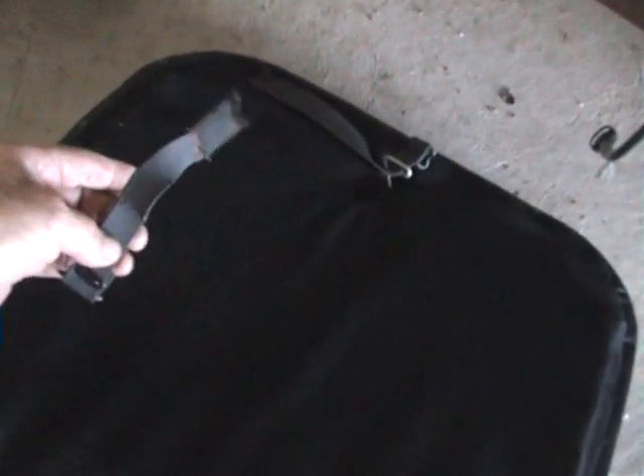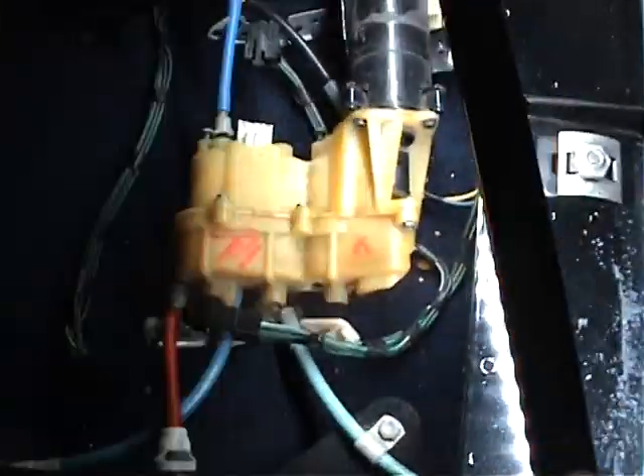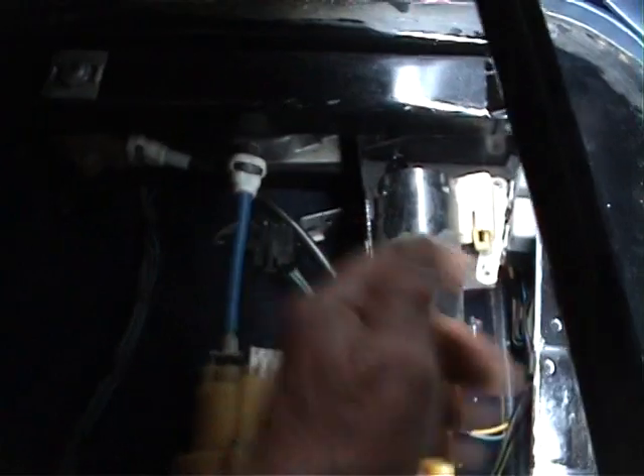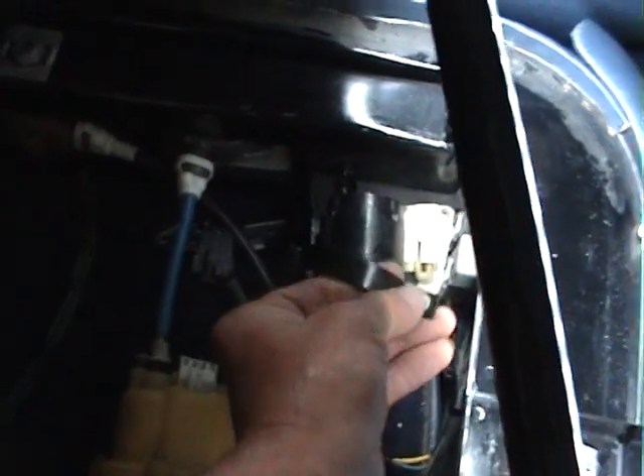On the bottom of the seat there's a strap which connects somewhere — this one's broken, there's the other piece. I don't know why, in case you lose a seat I suppose. This is my old gearbox here, the motor there, and to get to it there are three electrical plugs: one here, one over here, and one that goes up to the motor over there. Just unplug them.